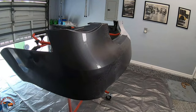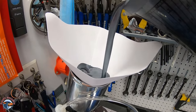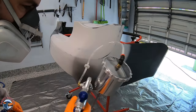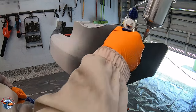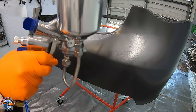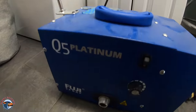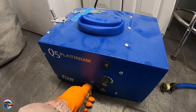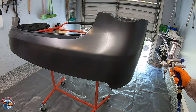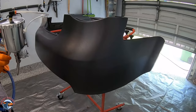Last but not least, we'll do one final clean with solvent-based cleaner — you can never be too clean. Always a good idea to strain your base coat before you spray. We're tack ragging it off, making sure any last bits are lifted. Then we go ahead and spray our first coat with the Semi Pro 2. I notice the paint is coming out a little bit thick, and although there is a learning curve with setting up your paint gun, something just wasn't right — it wasn't atomizing the way I'm used to. So I disconnected it and went back to the Q5 and pumped it up. As soon as I got it all hooked up and sprayed that second coat, I could notice a big difference in the atomization of the base coat — it was much finer, smoother, what I'm used to out of a proper spray booth or any gun doing the job right.